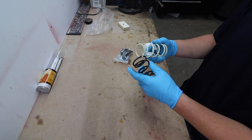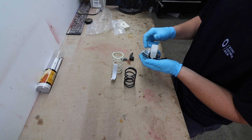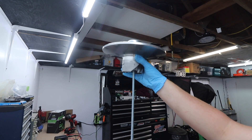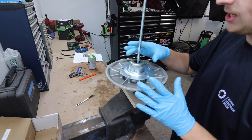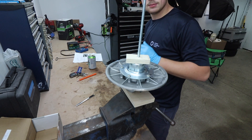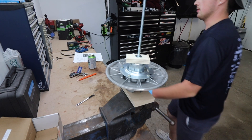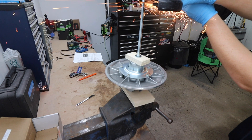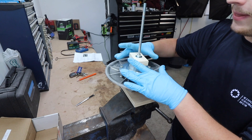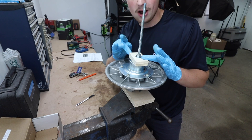So this is what I paid $300 for. You got your primary and this is a secondary spring. Inside this bag you got some little tiny weights, your main heavier weights, a big washer, and some hardware. Take this thing with the bolt side up, put it on a little stand, put this thing on it — that's your little block — put a washer and then your nut. Now you tighten it up just a little bit and once you take these off, the pressure is holding down. Then you slowly back this thing off and it comes up. Instead of spending a hundred dollars on a tool, I'm just doing this for free.